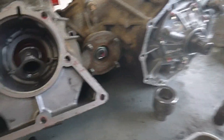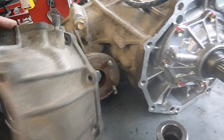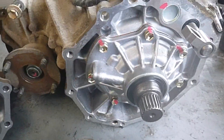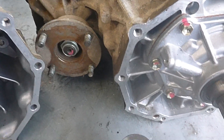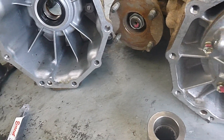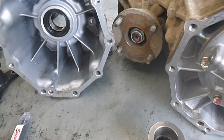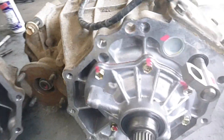Just a note when you're doing these: I had to go through yesterday and get the old tap out. The bolts in the gearbox are 10 by 1.5, and the bolts in the transfer case are 10 by 1.25. So when I got this box it had 1.5 bolts partially screwed in. I had to go through and clean all the threads — tapped them all out, cleaned them all up, and they've all come up real good. I was a bit worried they weren't going to work.